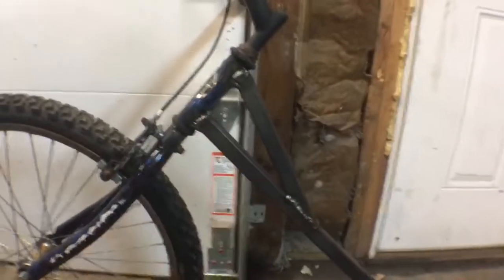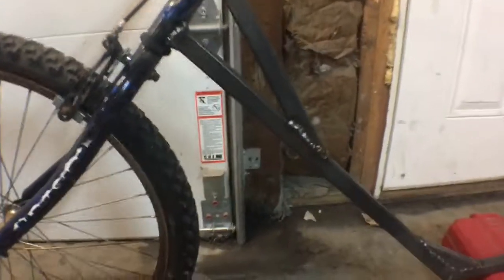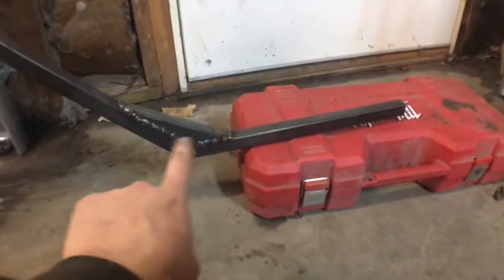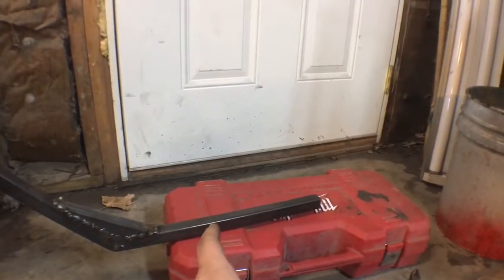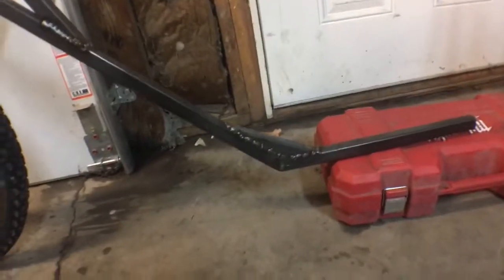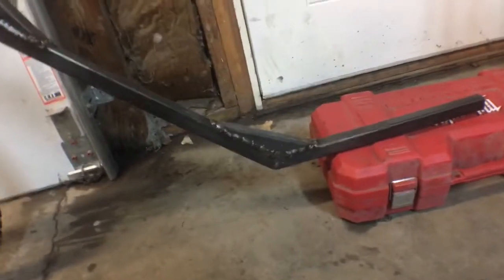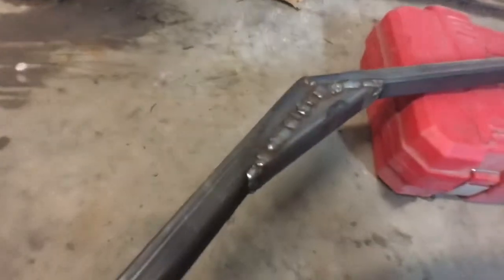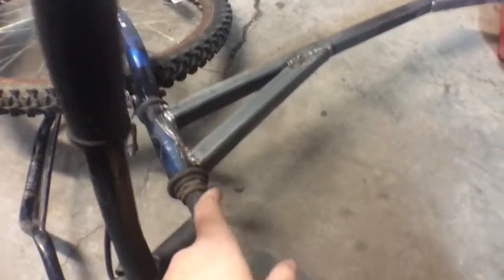This is what I came up with — just made a triangulated piece. I cut it on a nice angle and then down here. I didn't want to bring a big piece across because I don't want it to hit me in the crotch. So I took a six or seven inch piece, cut a big angle this way and a little angle there, and there's a little gap in the center — I just welded it solid. You can see my welds are getting better, I'm playing with the settings. Not the best welder, but I can make things stick. This side was definitely getting better — nice and flat up here. I think I had some paint on it and that's why it's a little rough in spots, but there's plenty of penetration and the weld is pretty nice.